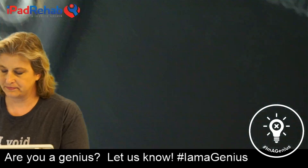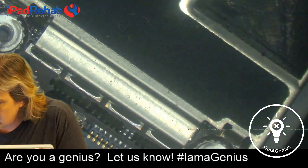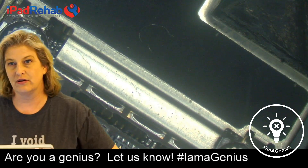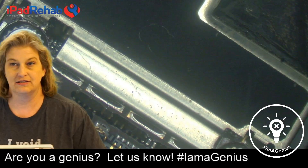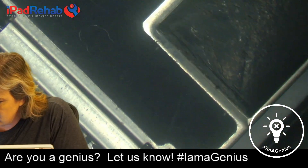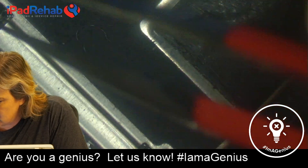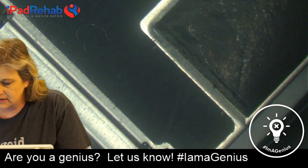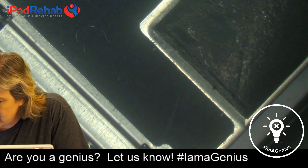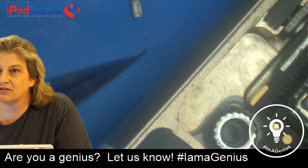The common failure point for a VCC main short is one of the two caps right here in the corner — two VCC main caps next to the backlight coil. That area tends to get hot and those caps tend to go bad. The safest thing we can do is simply remove one of these capacitors and see if that relieves the short, rather than using heat right next to the CPU under the shield.